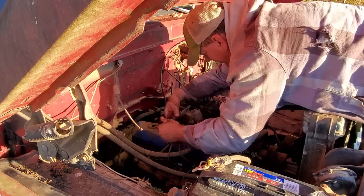Well, there's my brake line I just made right there. Got her put on. Seems to fit pretty good. So let's head up front and I'll fill the master cylinder up. Let's try to bleed this thing again. Well, here's where we're at with the brake situation. It ain't looking good. I can't get any pedal. I've bled three of the four wheels, and well, I'm on the driver's side now, and see the hose over there?